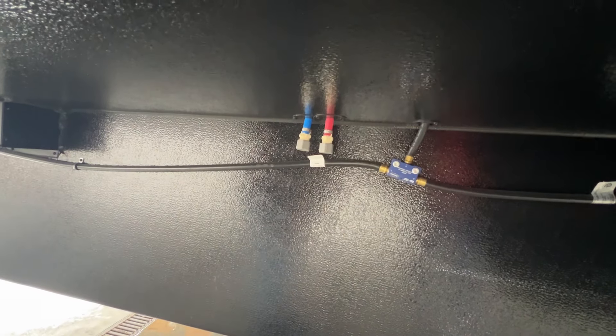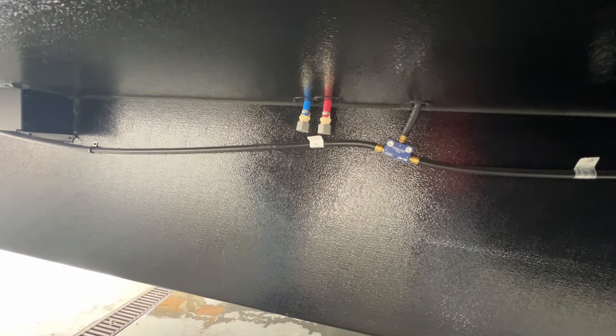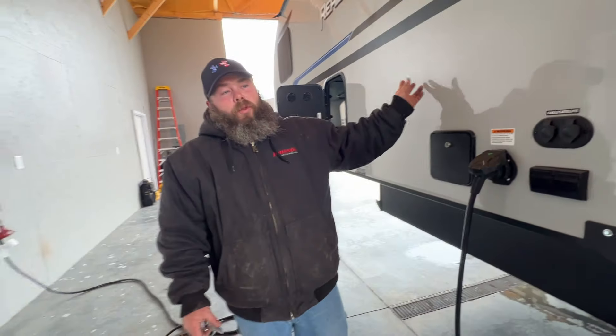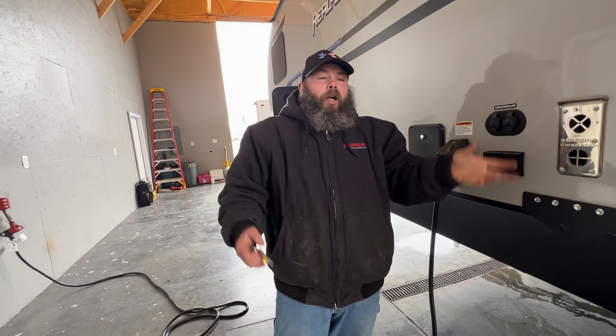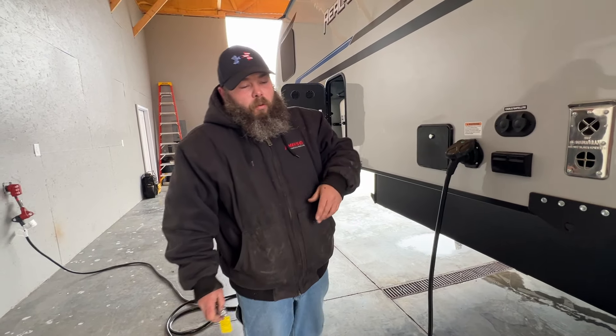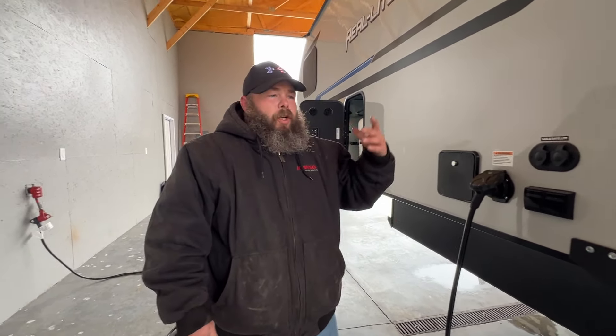Right underneath here is where your low-point drains are going to be. With those guys, it's whenever you go to winterize the coach — you are trying to get most of the water out of the camper. Take off those caps, basically go through and open up all your faucets, press the pedal on the toilet, try to make sure there isn't any pressure left in those lines. I always like to recommend when you're done camping, take those caps off, open up the faucet. As you're riding home, that air is going to blow through the lines and help push any excess water out so no water is left in there where it becomes stagnant.